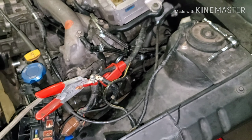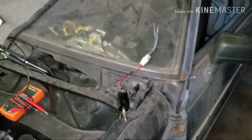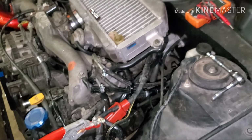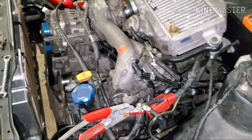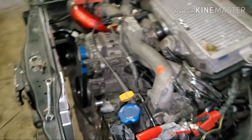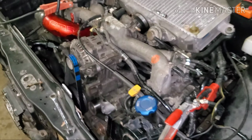Another thing that we kind of realized was, I think by the time we realized the plugs were bad, we had flooded it, because originally we thought it was a fuel problem. I kept priming the pump 2 or 3 times before cranking, and then when I went to pull that one plug, it was just completely soaked. So that's why the fuel line was disconnected, because I killed the fuel pump relay. I pumped the excess into that bottle, and then I left it unconnected, just cranking it, hoping the plugs firing would kind of dry up the fuel, but that didn't exactly work either.